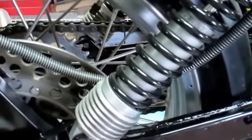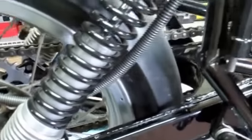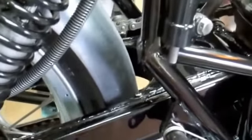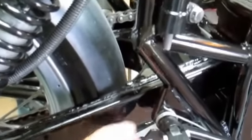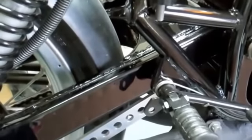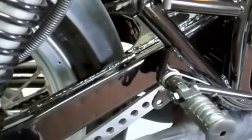That was also a modification that a lot of racers made during that time. One part that is missing is the link that goes from the rear master cylinder down to the pedal. I forgot to put a circlip on the pin and it fell out when I was test riding the bike last time I took it up and down the road.